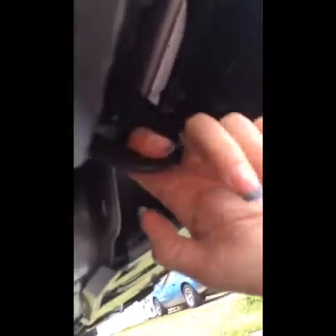You're gonna see the link where when you get towed professionally, this is where they hook it up to, and you need to remove that. To get to that you need to remove this box — you're gonna see two quick-release clips right here. Use a straight head, flat head screwdriver to pop those out, and then you're gonna see a nut back here that needs to come off.